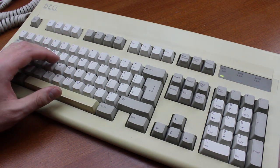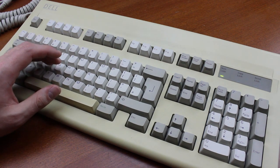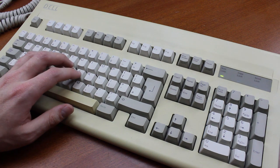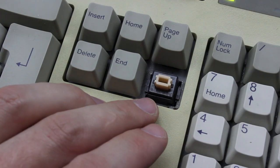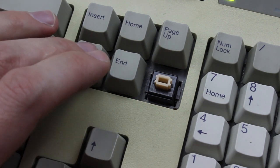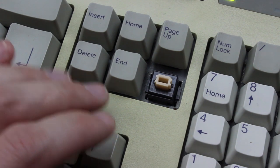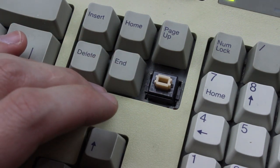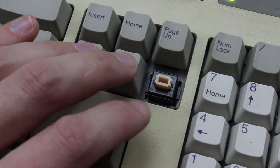Because it was pretty dirty and kind of bashed up, the switches felt scratchy. I gave them a clean, like in my Alps Switch cleaning video series, and this made them a bit better. They're quite okay now, although still nowhere near as good as new old stock ones, of course. The switches are, in fact, Alps SKCM Salmon, which is a second-gen type of tactile Alps switch that Silitech never used. All the versions they made used the more common Black Alps instead. Salmon Alps are somewhat stiff tactile switches with roughly the same weighting as Black Alps, so around 70 grams of force at the tactile bump, and if you get them in good condition, they're excellent.